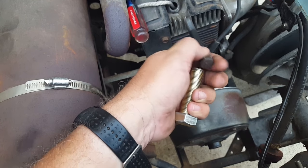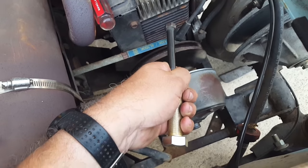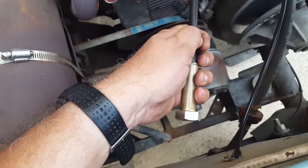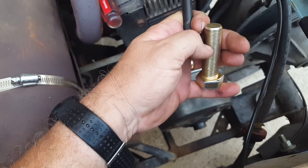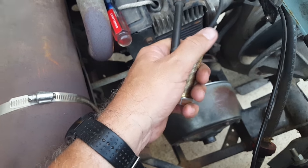So I'm gonna try this first. I'm gonna flip this around so it doesn't tear up the end of the shaft, and then try to fit it in there. If it doesn't fit I may have to cut the end off and grind it rounded and smooth. The other thing I'll try if this doesn't work is to pack that thing full of grease and hopefully that, threaded in as far as you can get it, would be enough to pop it off.